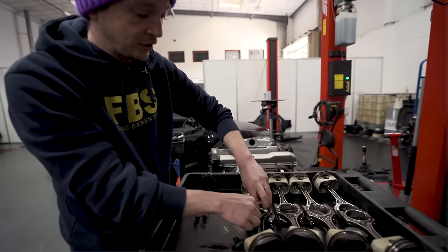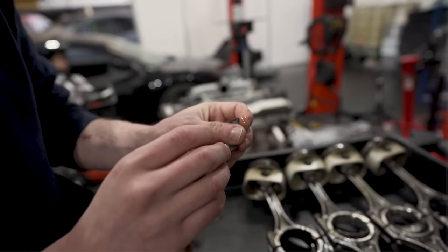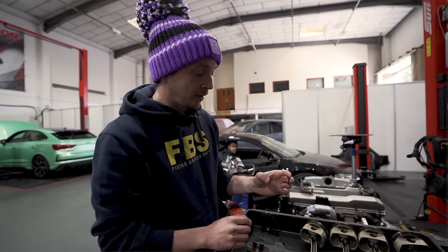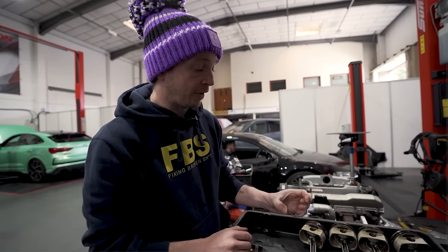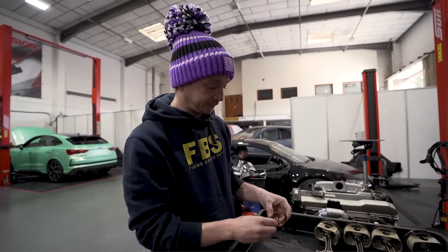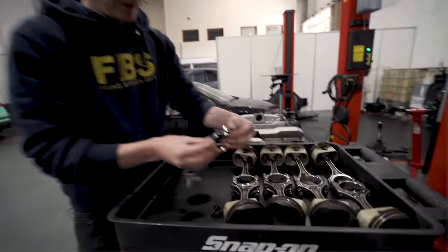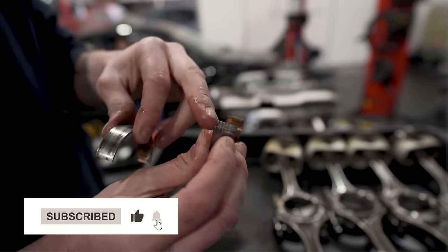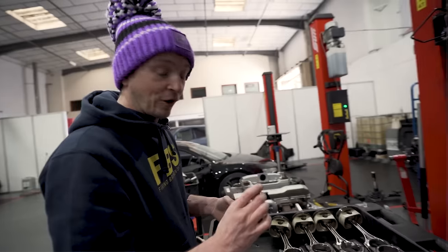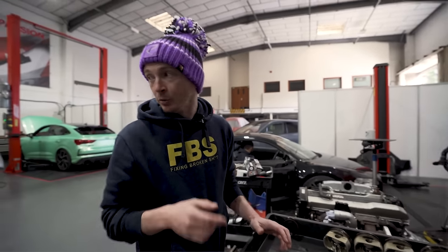A lot of the bearings are the same — there you go, that's the opposite end of the engine, they've done the same. It's almost like the oil degraded or there was water in the oil that damaged the bearings. What happened is it created a cavity, the oil sank in, grabbed the crank, grabbed all the bearing and it spun the bearings in the rods. Instead of being across the parting line, they spun — you can see where it snapped the locating tab off. The crank looks mint though for how bad it was.